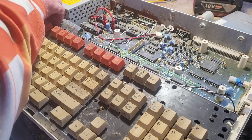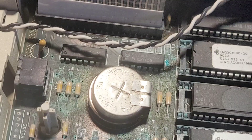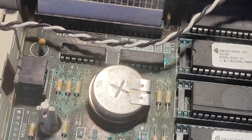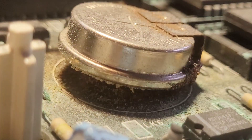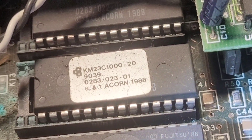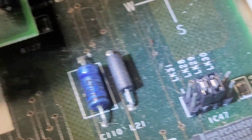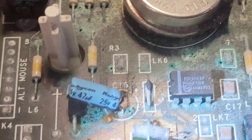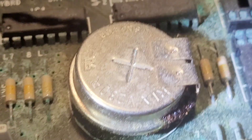I'm not sure how the keyboard comes out. Oh, there you go. That is a huge battery — it's like lifted off the board, so obviously something not 100% right there. There we can see the rear corrosion. Look at that. There's definitely some obvious corrosion around the capacitor there and a lot around the battery.